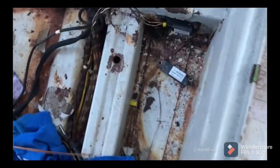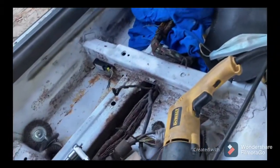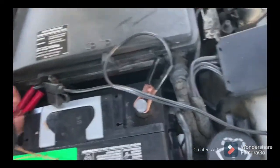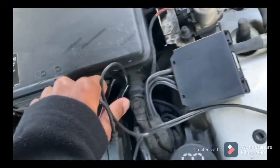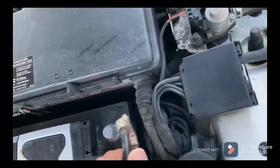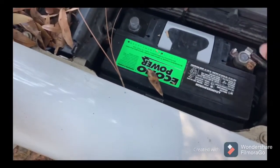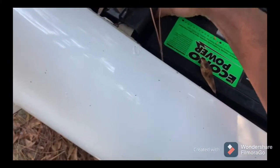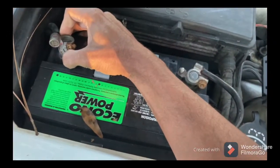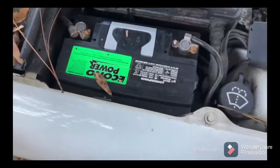So far so good — the new sensor on the passenger side and the driver side are plugged in. I forgot the battery is hooked up; I probably should have disconnected it. But it is disconnected since I've been charging just the battery itself. Let me go ahead and plug in the battery connection — positive then negative — and pray to God the airbags don't deploy. Let's just touch it for a second... hey, we got power!